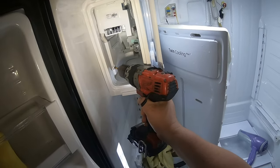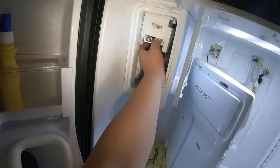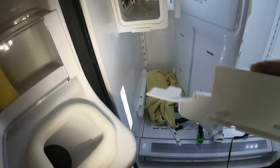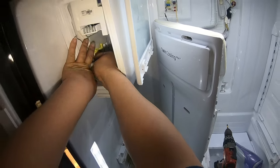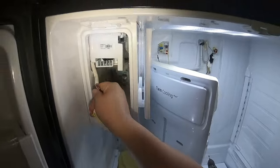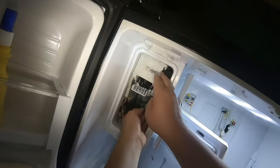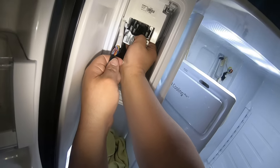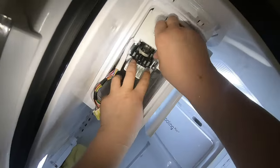The ice maker is a different story. We're going to remove the Phillips screws and remove the cover. Let's put this to the side, and now we'll start removing the ice maker. Remove the cover — it just snaps out, it has a tab in there. You'll feel when it snaps out. We're going to disconnect the ice maker harness — it's another press-and-release connection. In this model, you have to pull the bottom cover down to be able to remove the ice maker, and there will be a silver tubing that needs to come down for the ice maker to come out.